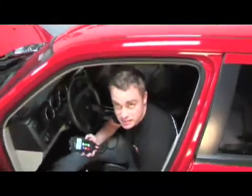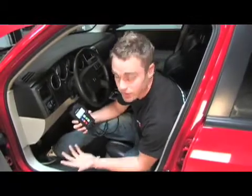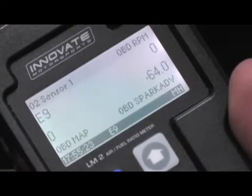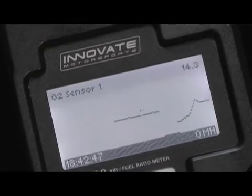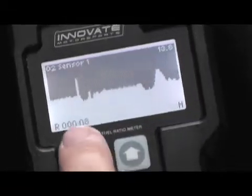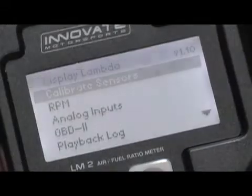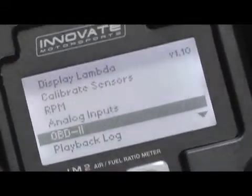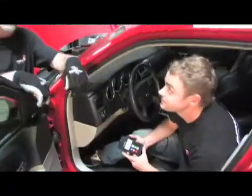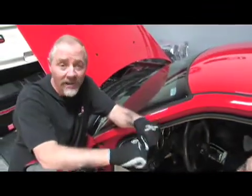While BJ's been up front working on that, we've been going through the setup process. It's a pretty simple affair. The first thing we had to do was configure the channels on the configuration screen — we've chosen four: the O2 sensor, RPM sensor, spark events, and a map sensor to measure boost levels. Check out the log trace of the OBD-II data. Reading and clearing DTC codes is as simple as choosing OBD-II on the menu, selecting get DTCs, and if there are any error codes they'll be displayed. To clear them, simply choose clear DTC codes. That gives us a full OBD-II scanner in our wideband at no extra cost.